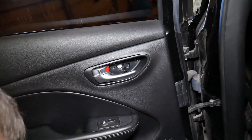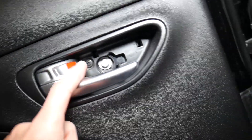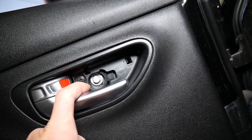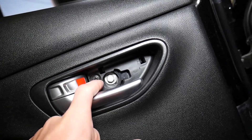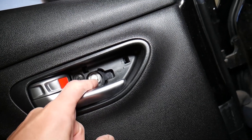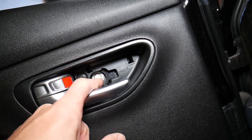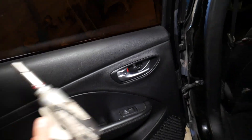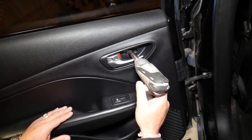It's coming loose but we need to replace the battery on the impact wrench because it's been extremely cold here in the shop and at night it died. Now as you can see we have another screw right here — do not remove this one, because this is holding the exterior door handle to the door panel; this one stays there. The only bolt we need to actually remove now is that 10mm. Sometimes those are super, super tight — I don't know why, but sometimes they're super tight.